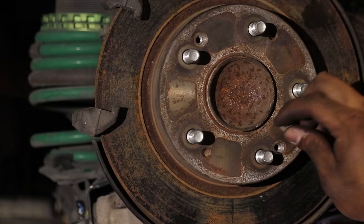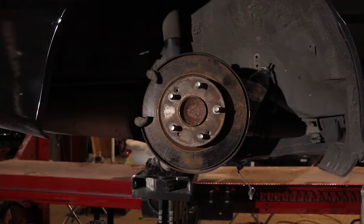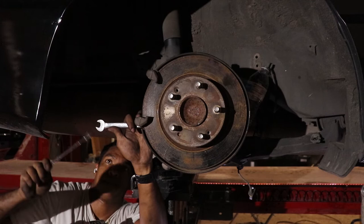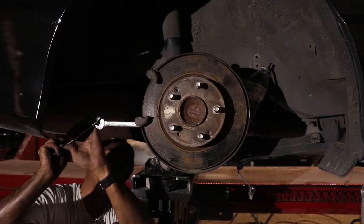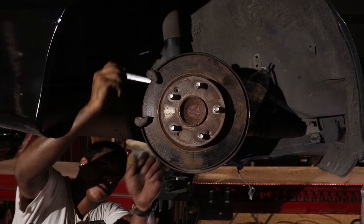I'm going to remove the caliper bracket here. Today's tool tip: use two open and closed ended combination wrenches hooked together to make a longer bar and increase your torque. Another tool I'm very fond of is this electronic ratchet — it really speeds things up. Those things are a little bit overpowered, but they work really, really awesome.